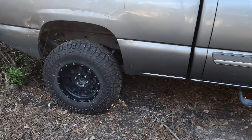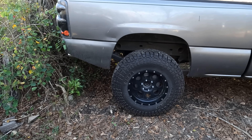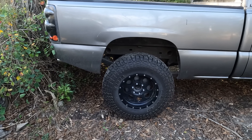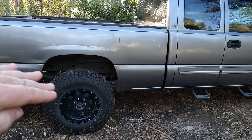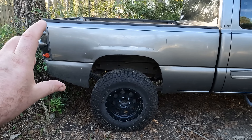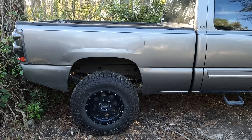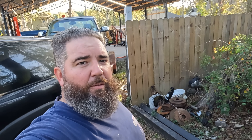In the rear with the Deaver 10-leaf, I think it was a 12-inch lift over stock. I have some two-inch drop hangers to adjust my pinion angle and still keep that big spring and the long-travel drop shackle in the rear. The rear is supposed to have 16 inches of travel, the front is supposed to have 10, with a 450-horsepower crate motor and 430 torque - which is kind of like the specs of the 3.5 turbo Raptor. Suspension is kind of like the specs of the 3.5 Raptor - the only thing I don't have is the reservoir shocks.